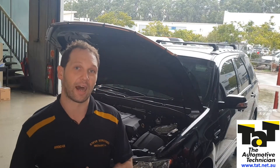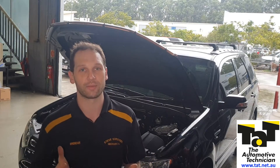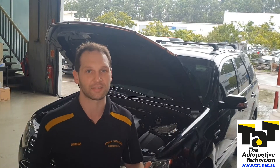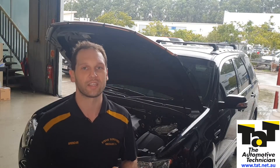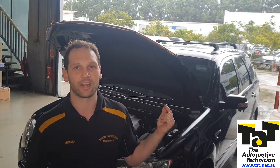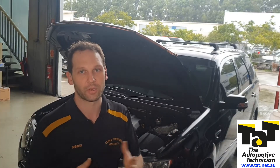There are a lot of articles about this, a lot of guys getting caught after doing a fuel filter and having the same situation. To be honest, I just really didn't subscribe to the fact that people are saying the pump is dying through the bleeding process or something like that - it doesn't make sense at all. From what I can see online, there are two real symptoms: either you're a mechanic who's done a fuel filter, you go to prime it, and you find the lift pump doesn't work. We now know it's dead.